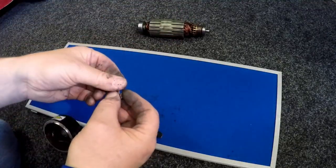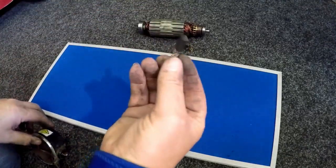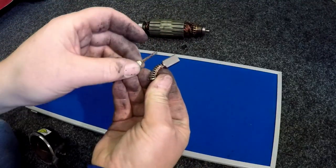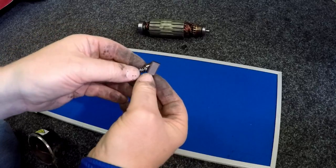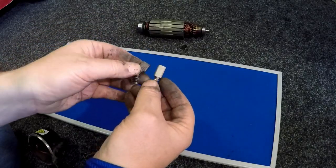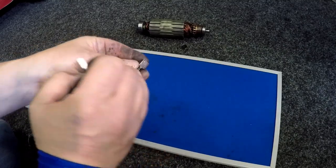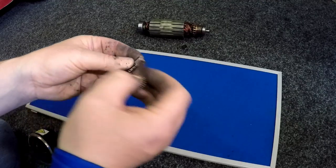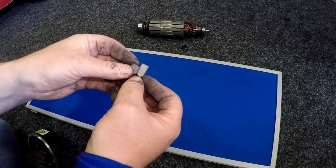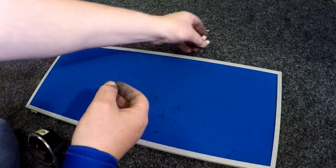The best and quickest thing to do is get the motor replaced. By the way, that's what a new motor brushing looks like — you can see the difference: nice and golden versus how dark that side is. That's a 6×10; the 43 here is a 7×11. You can see the difference — it's still okay length-wise down to the wear line — but since it's in for a service we might as well replace it while we're at it. So I'm going to show you how to do that on this particular scooter.